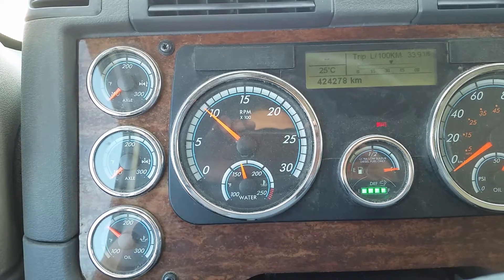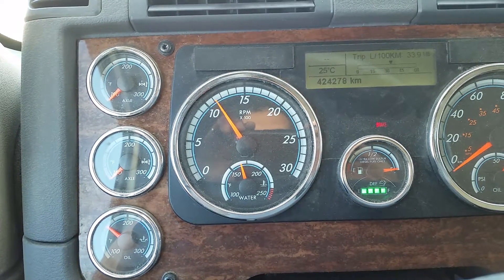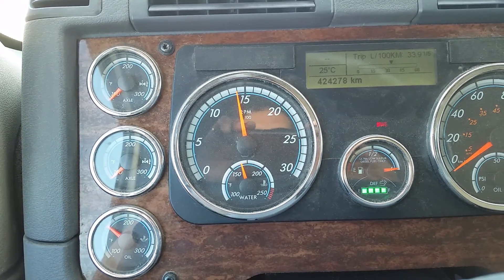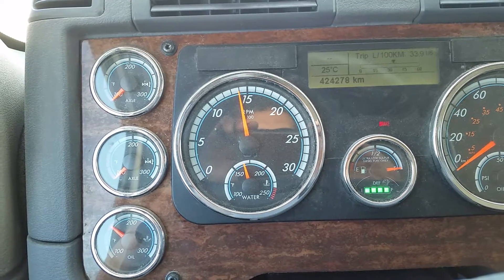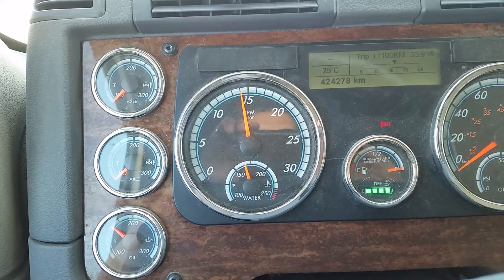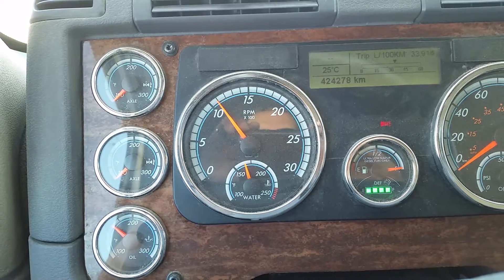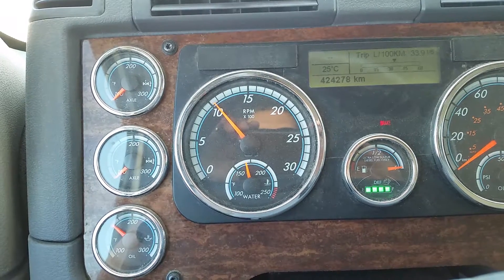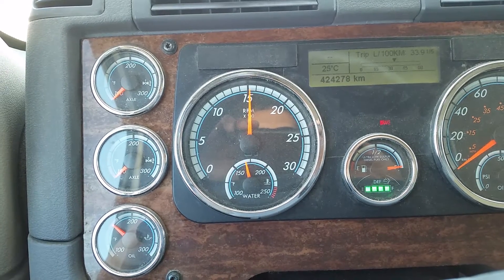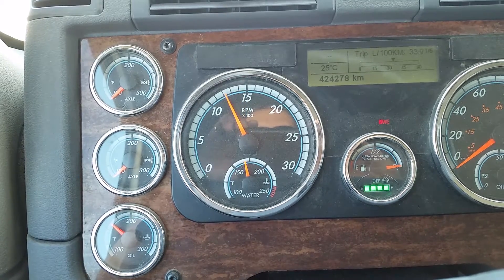When you shift, you're basically going to keep your RPM between 1000 and 1500 RPM. Whether downshifting or upshifting, you want to get to know the throttle — give yourself a relationship with it and understand how hard you need to push to raise the RPMs and how much to let go to lower them. I suggest raising up to 1400 or 1500 RPM and holding there, then bringing down to about 1000 and holding it there.